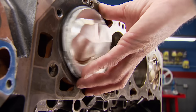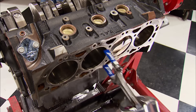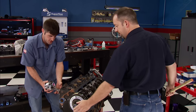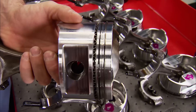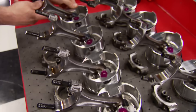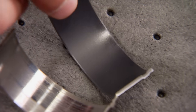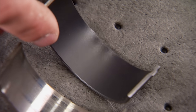We can remove the rod and piston assemblies. The rods are a heavy-duty forged I-beam design that measure in at 6.535 inches. They're being reused and sufficient for the power and RPM we plan on running. Everything looks so good on this motor. The forged aluminum pistons sport a 1/16th, 1/16th, 3/16th ring pack that we'll improve on later on. Plus, these things are going to be good for a little power adder we have planned. Standard-sized Clevite bearings that are uncoated came in this engine. There's minimal wear, which stays true to the little runtime the top end showed.